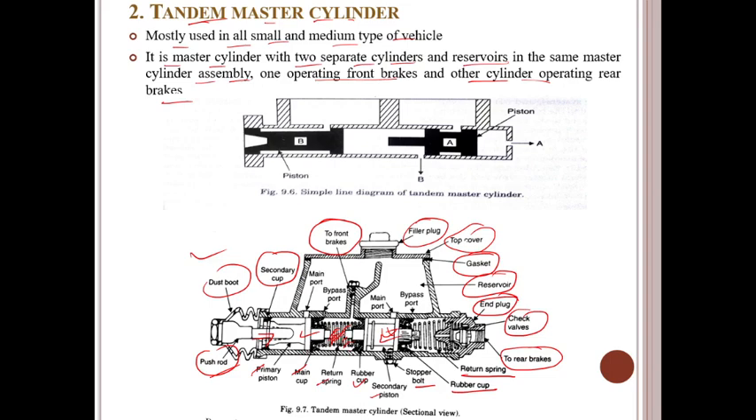How does the master cylinder bore diameter influence braking performance? The master cylinder bore diameter is an essential factor. A change in the cylinder diameter affects how the brake pedal feels and the brake pressure applied. If the cylinder bore diameter is too large, it will create a hard brake pedal — you will need extra effort to press the pedal. The brake pedal does not travel far enough to generate sufficient braking pressure, resulting in a jumpy car as you have to tap the brakes hard due to high resistance, and the brakes engage too fast.